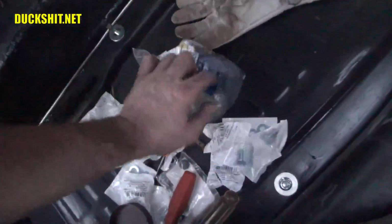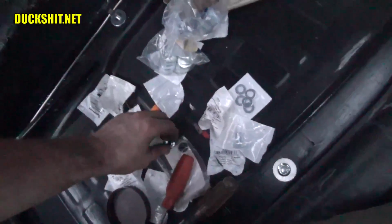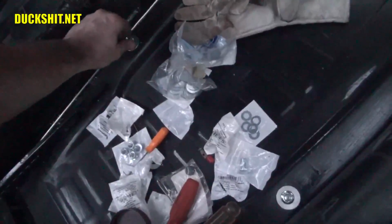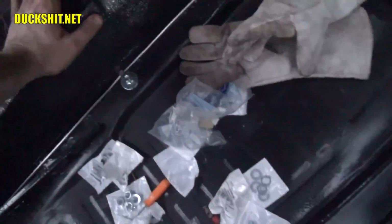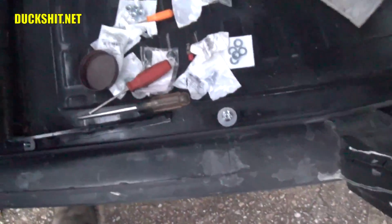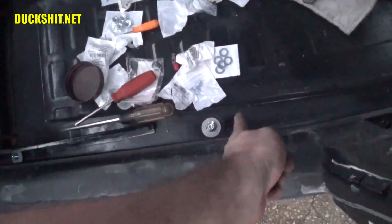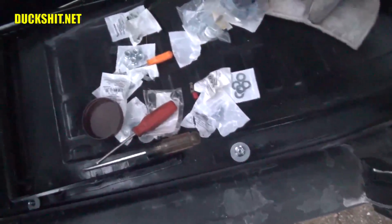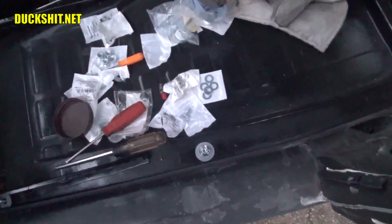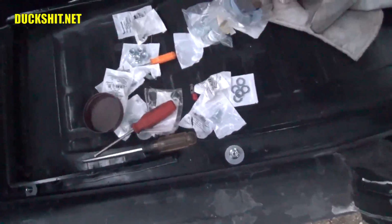All this stuff in here is all my mounting hardware for my seats. You can see I started to put some of the bolts here on the floor to see how everything would work out, and it looks like I'm going to need some longer bolts. But I had a pretty good plan as to what I had going on here with some nice fat fender washers to help spread the load. I did want to go in here and put some flat bar on top of the floor instead, because this sheet metal is kind of thin, but a nice piece of flat bar, about 6 inches long with a hole in the middle, I think that would certainly make this a whole lot stronger. And do the same thing to the underside, and maybe even weld it in. That would just make it tremendously stronger.